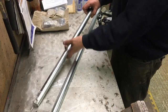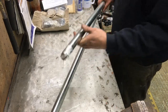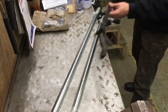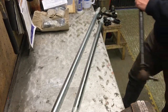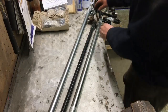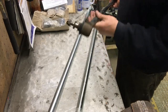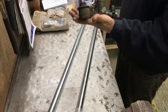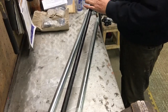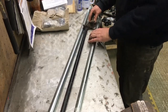With this kit you get two bars. This is the steering bar itself, and this bar here replaces this standard one here. As you can see on the standard one, there's a cranked end — it's just thin steel tube. I can lift it easily; it weighs practically nothing. It has a ball joint on the end which is non-greasable, whereas with this kit you're getting greasable ball joints. The cranked section is the bit that concerns me — if you gave that a big knock with some big tyres, I think that would be the weakest point in your steering.